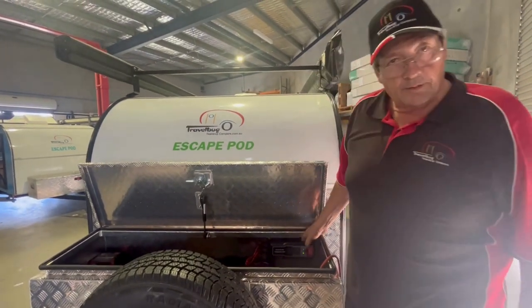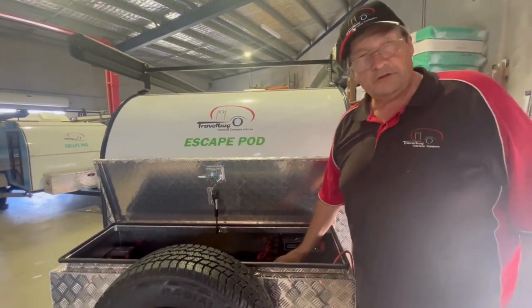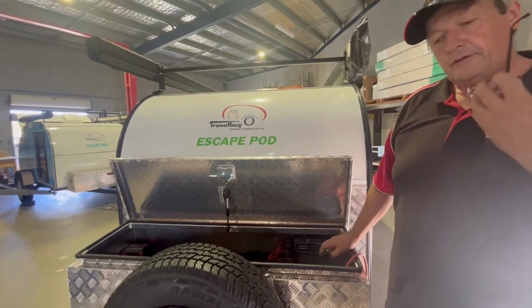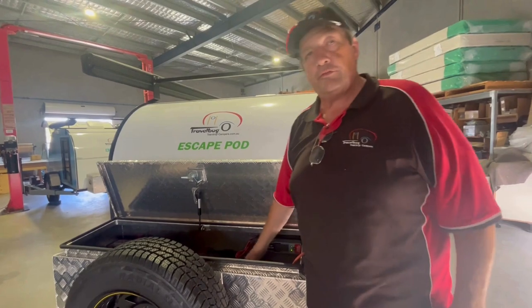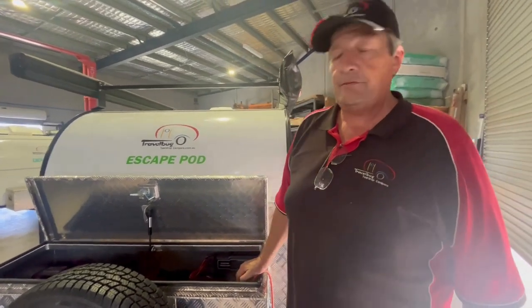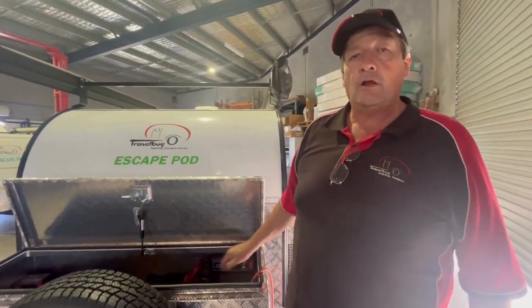You can hear the fan come on — that's perfectly normal. The battery is fully flat at 12 volt, and it's unusual that a 12 volt battery is flat at 12 volt, but AGM works like that. They do not like to be taken below 12 volt.